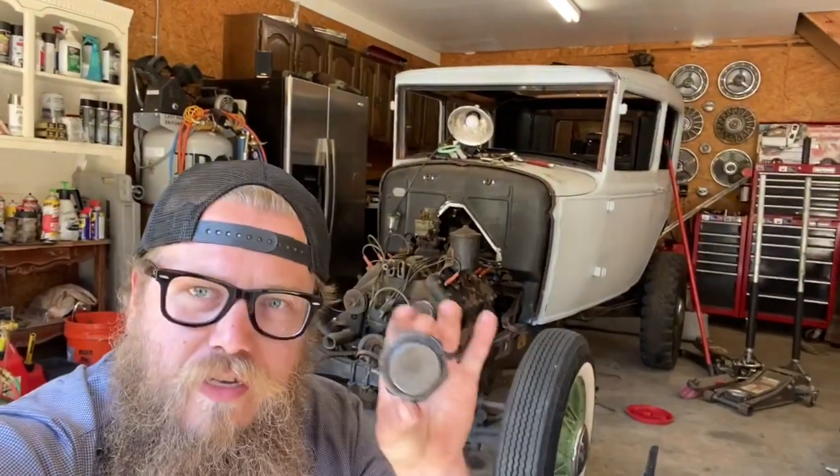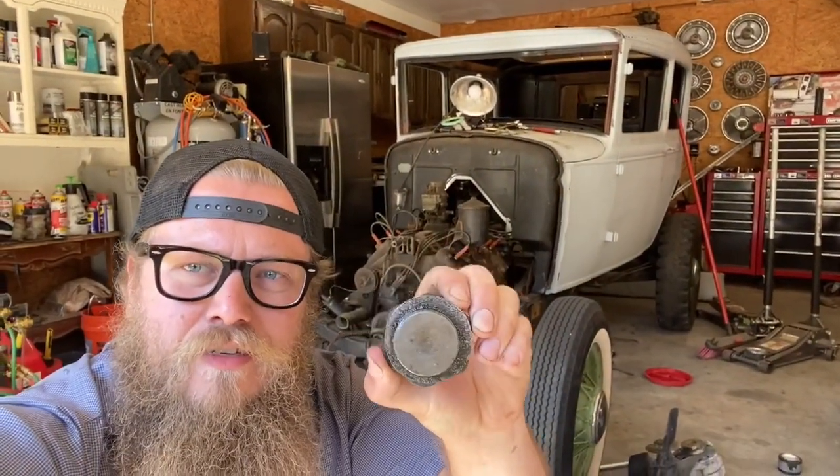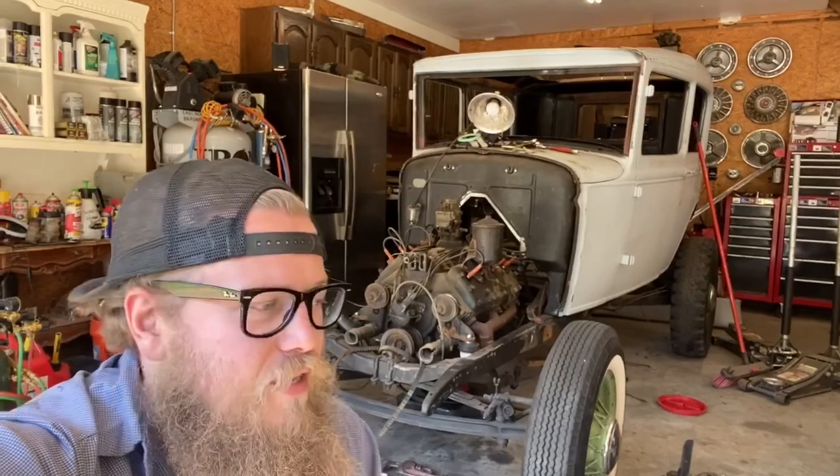All right, so if you're not familiar with flatheads, their drain plug is huge. Look how big that thing is. So I crawled up underneath the oil pan with my flashlight. From the drain plug, you can see the oil screen on the oil pump. You can see one main, a little bit of the second main, or the rear main, and you can see a couple of rods.